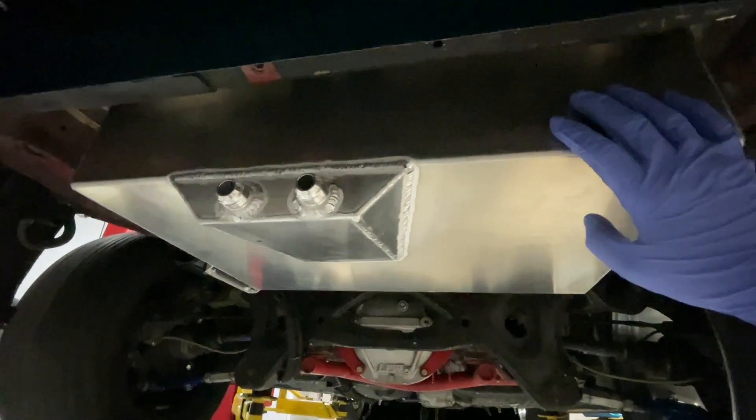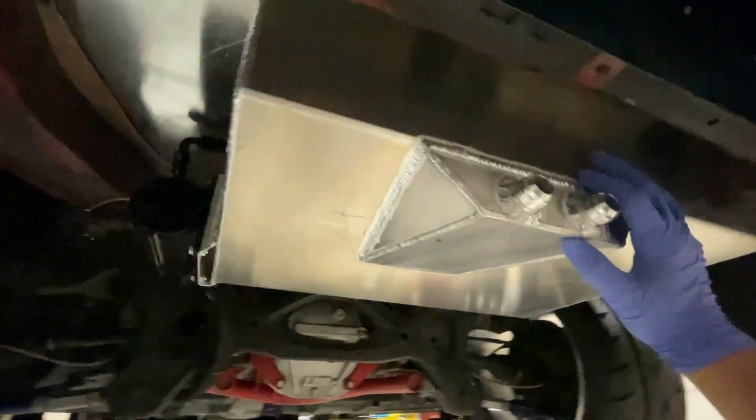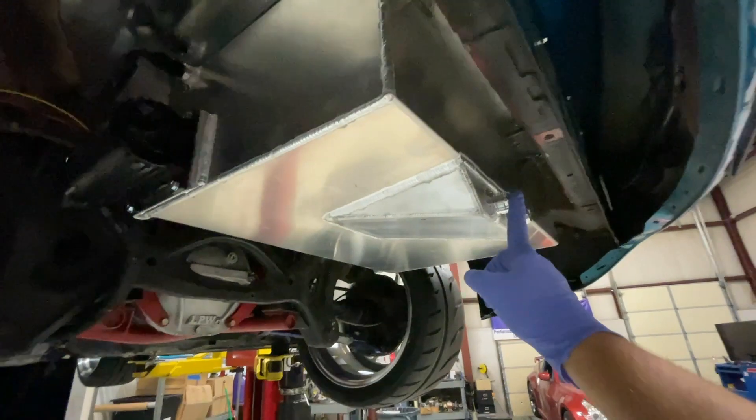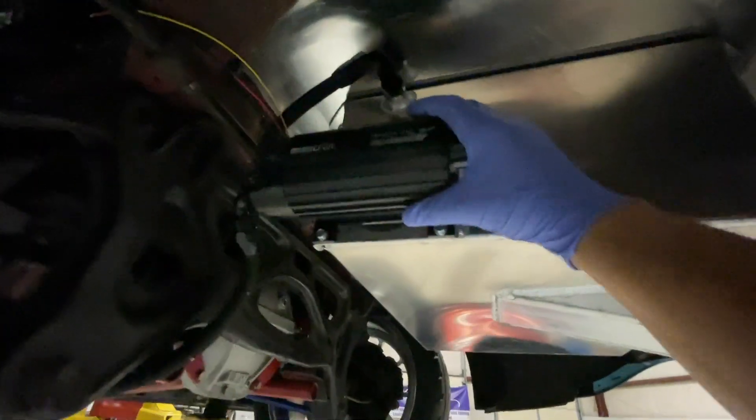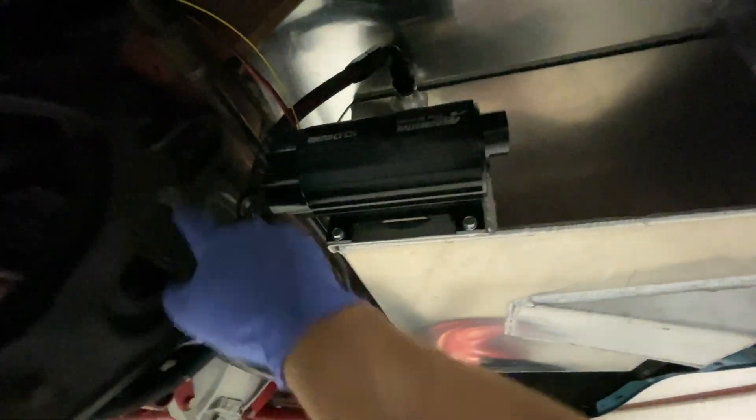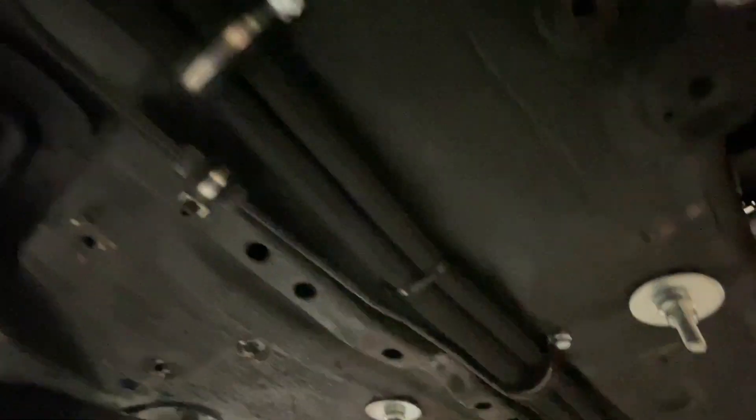Under the car — the fuel cell stuff Michael knocked out and killed it, so the whole trunk is flat-bottom now. Aluminum cell from Rock Solid Motorsports. We had to sump the tank and I have a single feed going to my Aeromotive 10 GPM pump — that thing is a killer. I plumbed the fuel system with a 10 AN feed line and an 8 AN return. The feed and return run together, P-clamped and nutserted all the way up to chassis, to an inline Fuel Lab filter, then fuel line feeds up around the top of the rail.